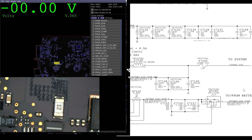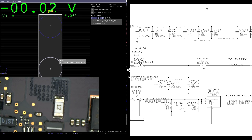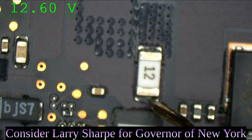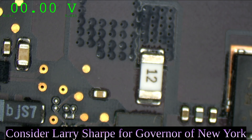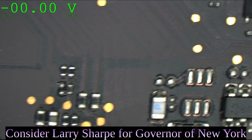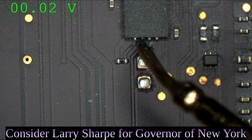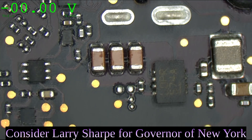Where would we find our PP bus? We can find it on fuse F7140. Let's check what voltage we're getting on our PP bus. 12.6. That means the SMC is turning on. We can confirm that by checking SMC reset, which is present. This is going to be a difficult one. Or a real easy one. One of the above.